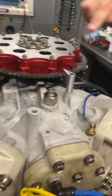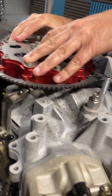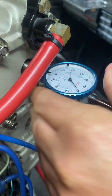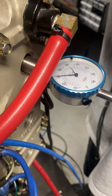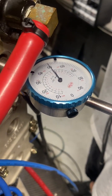We're going to turn the motor — this is a clockwise motor, so it rotates this direction. We're going to turn the flywheel clockwise until we find the highest point, which is right there. We're going to zero that indicator, then go back counterclockwise 150 thousandths, which is 25 degrees.